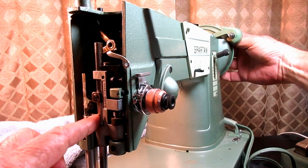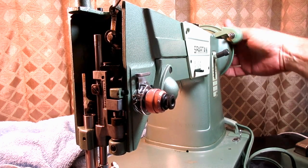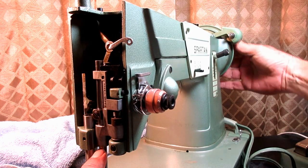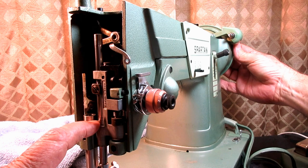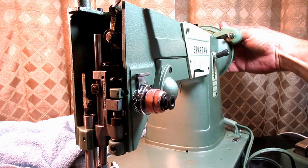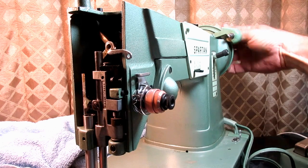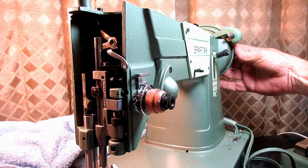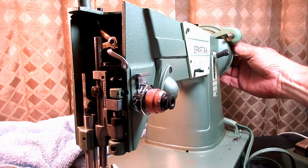Now, depending on where the bend is, you could just feel one spot binding, or you could feel two. For example, if it was in this area as it went up through the bushing, and then the bend cleared it, you would feel binding and then release, but then binding again on the way down. And that was not my experience. I just had binding in one place of the cycle. But I had pulled the needle bar out already and inspected it, and it was not bent.